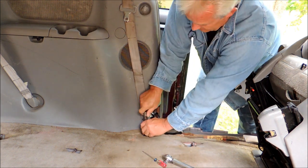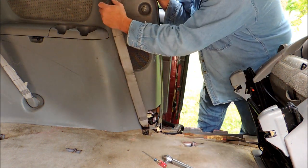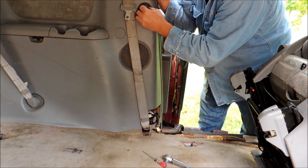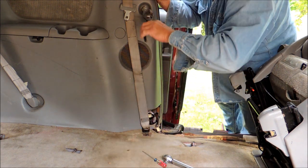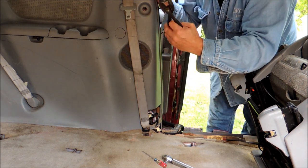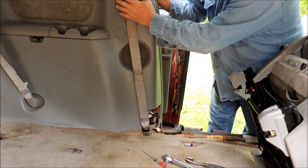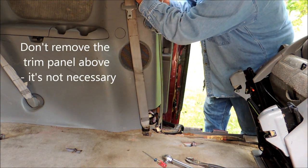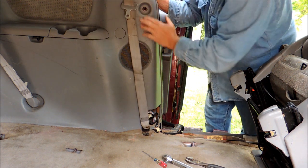Once that's off, I'm going to do the clip here. Up here there's a small plastic knob for the netting. Get yourself a pair of general purpose pliers, work it back and forth, and pull it out — no twisting; it just simply clips in. Now, important to note: the upper trim piece here, don't touch it. It doesn't need to come off. There's nothing you need to do — you're good, this is done.